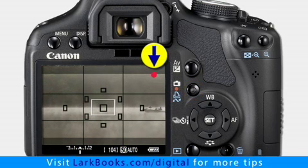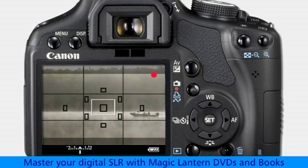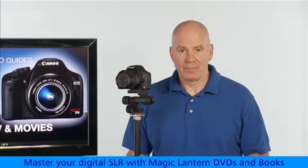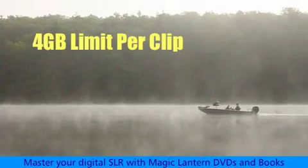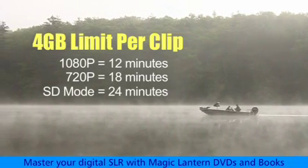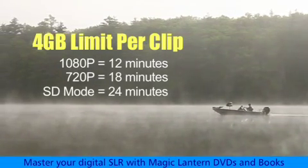Be sure to use SD cards with a speed rating of Class 6 or higher. Slower cards might not work properly. To stop recording, you just press the Live View button again. The camera will record video up to 4 gigabytes per clip, which equals approximately 12 minutes of 1080p video, 18 minutes of 720p video, or 24 minutes of SD video.